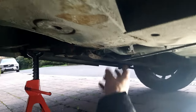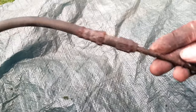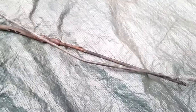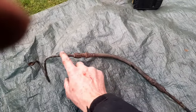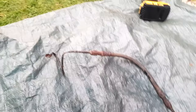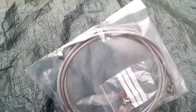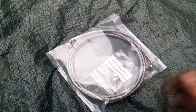There's one more clip I need to get off. That clip came away quite easily. So this is the sorry state of the clutch line — you can see some corrosion there. This is where it corroded through; I just snapped it off really easily. It runs a hard line under the car, then swings up through the flexi up into the engine bay and connects to the slave cylinder. I could have replaced just the hard line or the flexi, but it's easier to just run a single braided hose all the way — no joints, no connections, so it's more reliable.